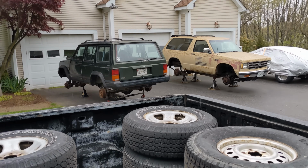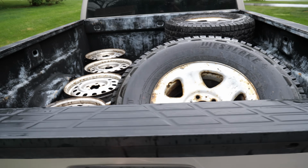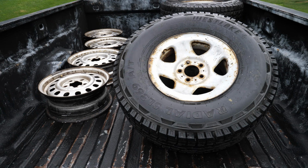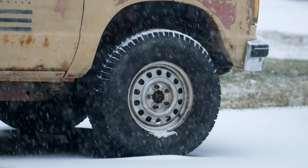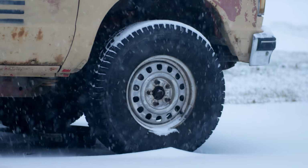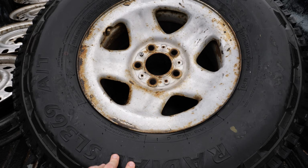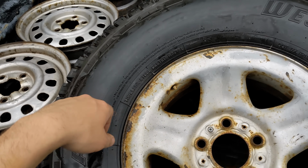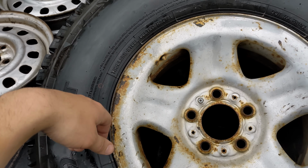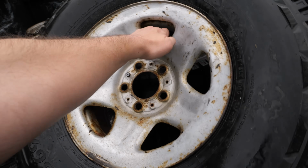We'll haul those over to the tire shop and were able to get them installed, but we did run into an issue. The Blazer had been doing a lot of sitting recently, and unfortunately this had left some flat spots in the tires. You could see some run out in them on the machine. It was showing like 5 ounces. So they actually didn't balance these. They took the old weights off and they told us the best bet's just to drive them around and see what happens. We'll see how they do.